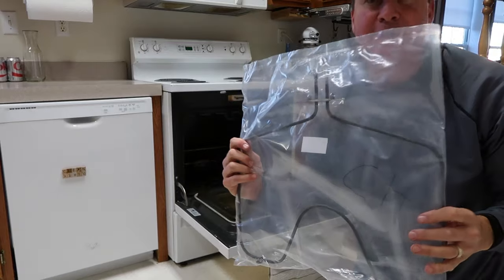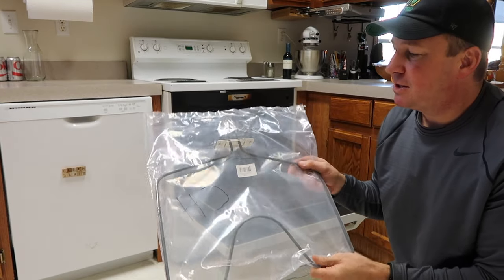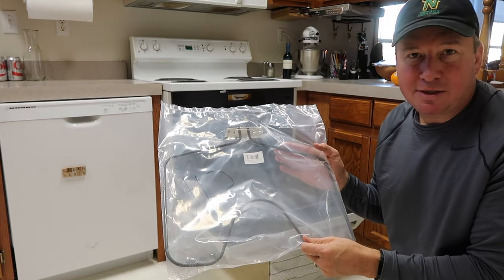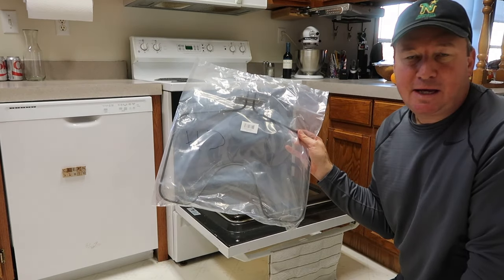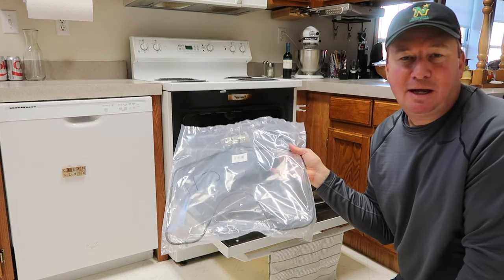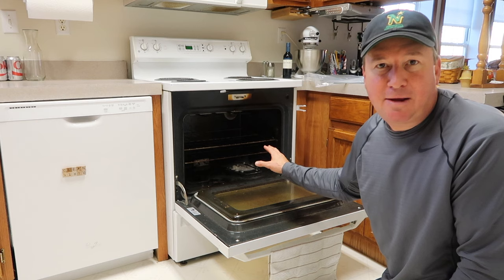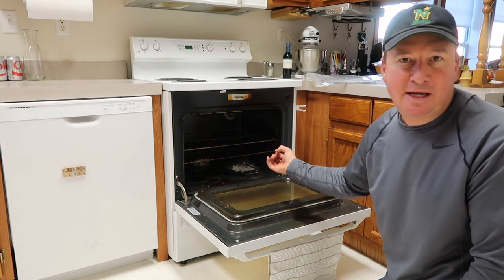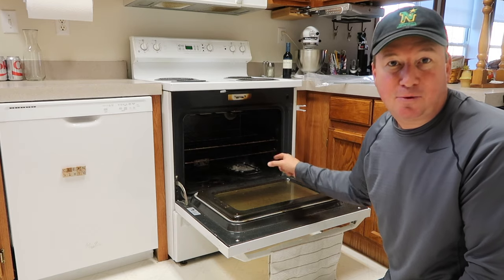I'm going to replace this element. There's only one store in town that sells appliance parts, and it's a little frustrating — it's about $45, and once you buy it there are no returns if there's an electrical problem. You can also get it on Amazon, from GE or other companies, ranging from about $20 to $50. I talked to a local appliance repair guy who said before it goes out, you'll see a red spot that glows bright red — that's a good sign to replace it.